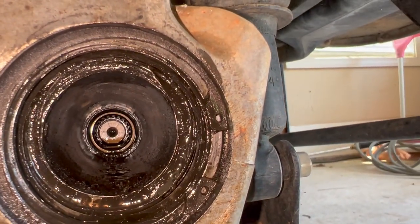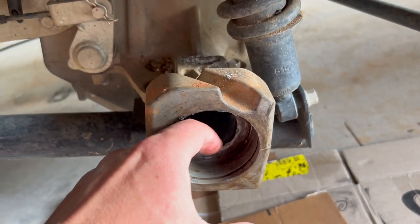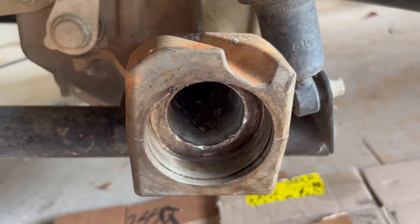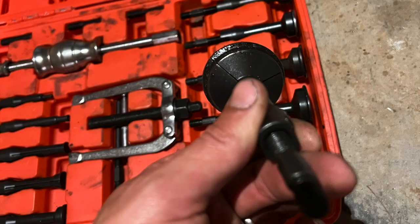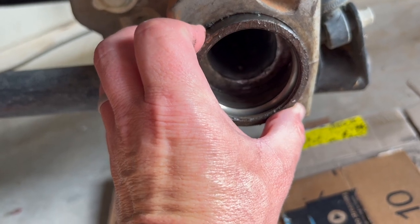If you're planning to replace the ball bearing and yours wasn't blown out, make sure you drain the oil before you get started. To get this out, we had some hooks that we stuck behind it. You can see we did mar up this edge a little bit, but I think there's enough surface contact here to hold the fluid in once the new bearing is pressed in place. This blind bearing puller set would have been ideal for this — I'll make sure there's a link to it in the description. This is what the outside ring for that bearing looks like after we removed it, and now we're going to move on to working on the shaft.